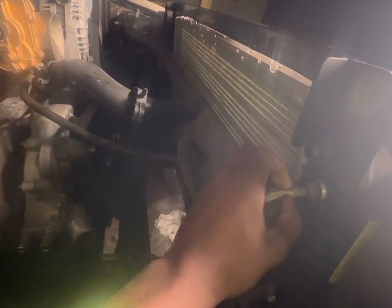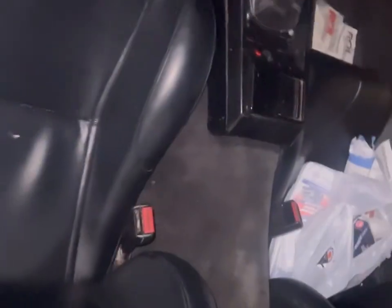I need to remove these spark plugs, remove this bolt, and these transmission lines. I'm thinking about doing a rubber hose - I looked into doing a TrueCool but I'm not going to do that. I'll probably cut right here, flare it, and just get a rubber hose so it could be more flexible. I might end up getting a radiator with an electric fan, probably mounting it in the back or up somewhere here.